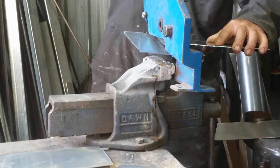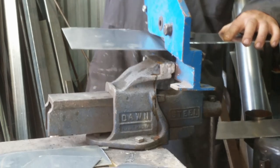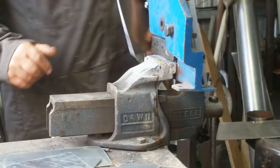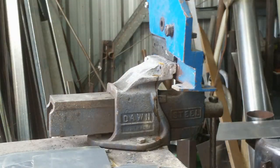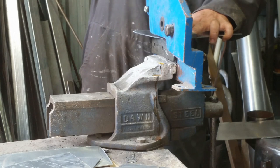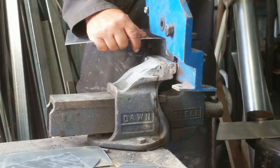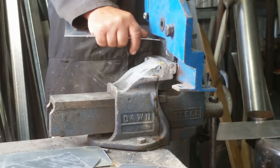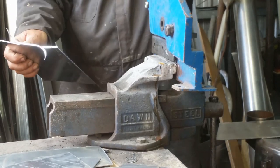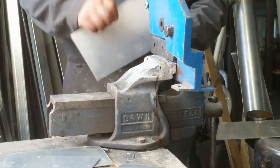First part of the job is to make the six legs — they're all exactly the same. They're made out of two millimeter aluminium, which I'm just cutting up here out of some strips I had lying around. The small piece cut out of the middle gets used for the clamping at the bottom. Now I have to notch out the top of each one very slightly because I want these legs to cant over at a small three to four degree angle.